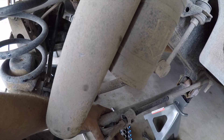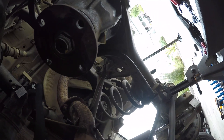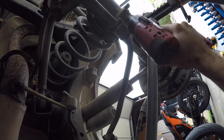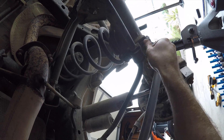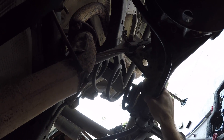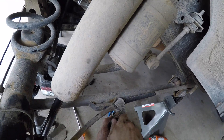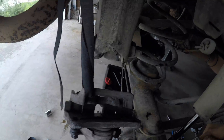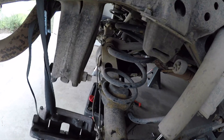You don't need to remove the calipers. Also take off this one bolt here that holds the brake line. Here's something you should probably thank me for: you need to remove the sway bar bolts before you can get the diff out. This is not obvious, and I wrestled with this 8-billion-pound steel pumpkin for way too long, unable to see why it wouldn't come out. So just unbolt both sides. It turns out you don't actually need to take off the brake lines — you just need to unclip them and slightly bend them to get the axle out. I hate brake fluid. Take the bolts out of the carrier and pull it forward. It's super heavy and kind of awkward while you're laying under the car, so be prepared for that.